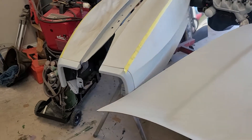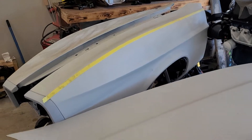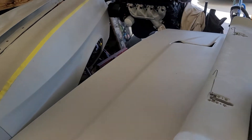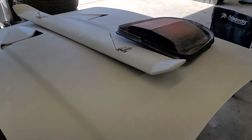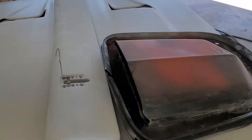You can see the fenders here with the little extensions on there - they're primed for the most part. Inside the little channel there where your body bolts go, I'm going to have to redo those, really give it a good sanding and a nice high build primer. The spoiler has been sanded and primed first with epoxy then with the Evercoat Super Build.